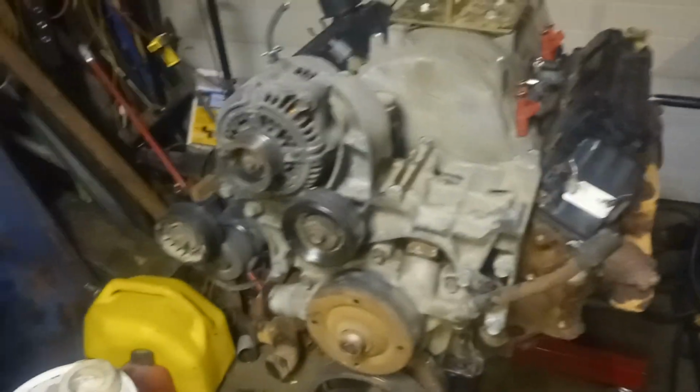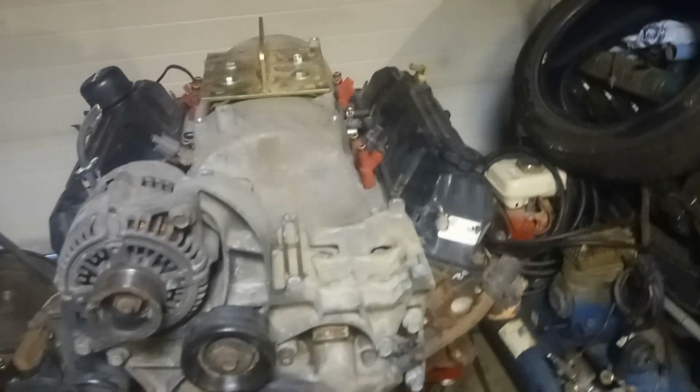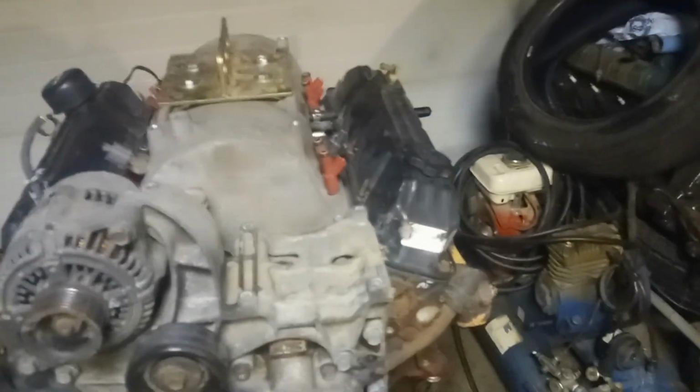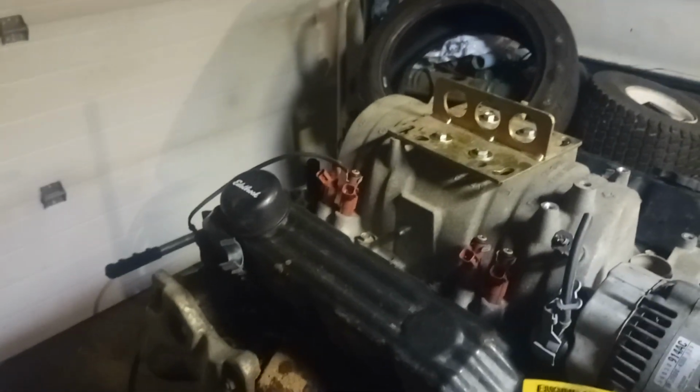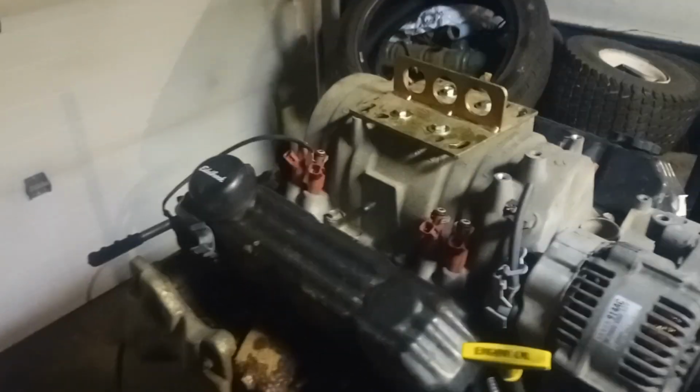But yeah, once I seen these cylinder heads he's got, they flow fantastic. They're just beautiful. There's nothing you can really do to them. Everything's shaped just gorgeous on them. So it should go pretty good. The motor's only going to be, we're going to use stock pistons, but with a thin head gasket, and those heads have a little smaller chamber. It's going to be about a 9 1/4 to 1 motor.